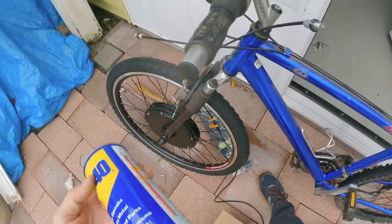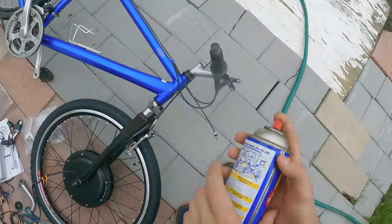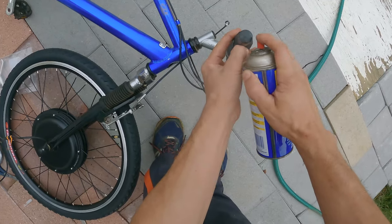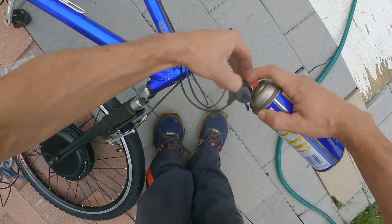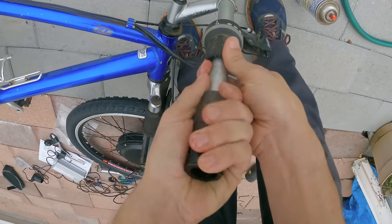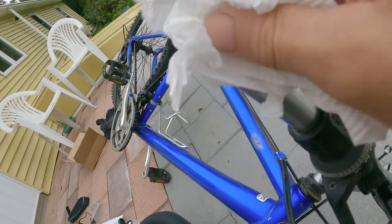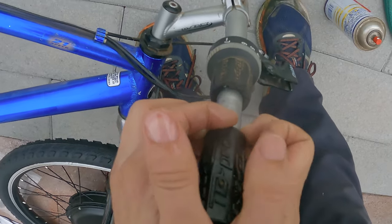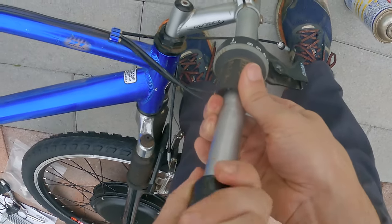I've got to get this grip first and I'm going to use WD-40 because it's really on there. The easiest way to do this is to spray a little bit in there, then pull with both fingers — it's not about twisting, don't twist. I just got it lubed up and then I took two fingers and I pulled straight up. It goes from being impossible to coming off real easy.